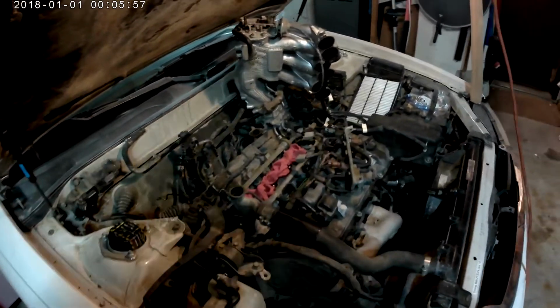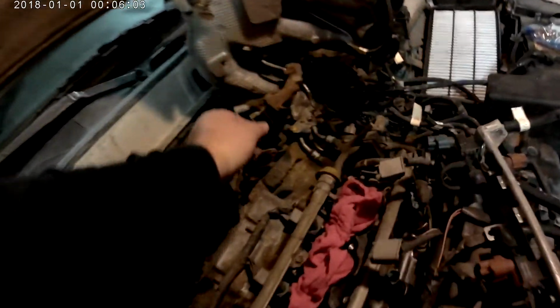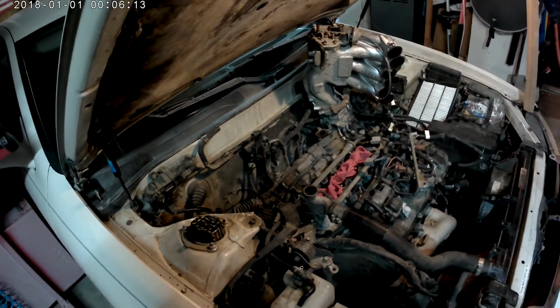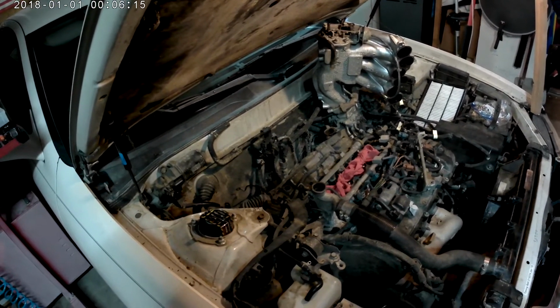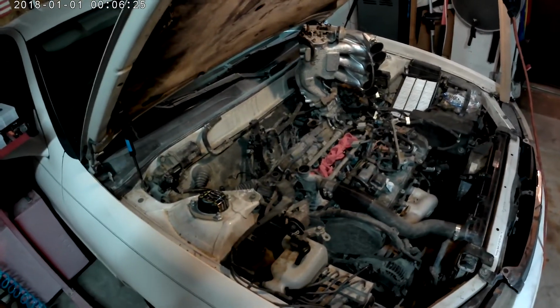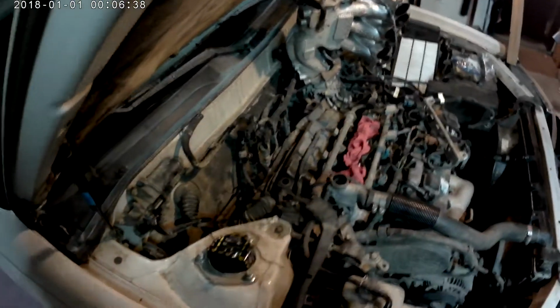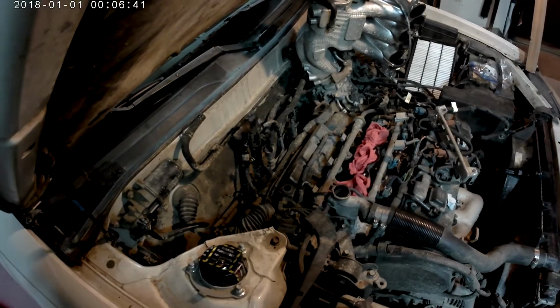So you can also see where I disconnected the EGR. You can see its gasket right there, which I'm going to take so I don't lose it. And that worked out pretty good. Somehow, I guess maybe this support strut wasn't connected. I guess the bolt either rattled out or it had been removed before another repair someone did. One other problem was the PCV valve, which snapped off when I pulled the hose on it.